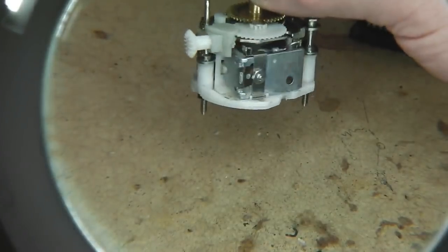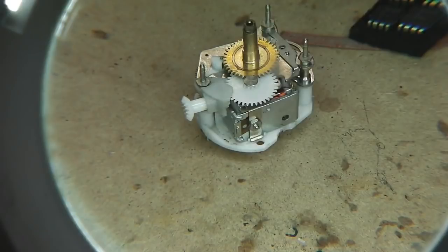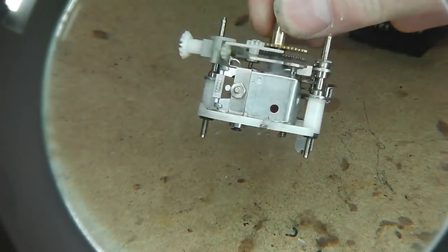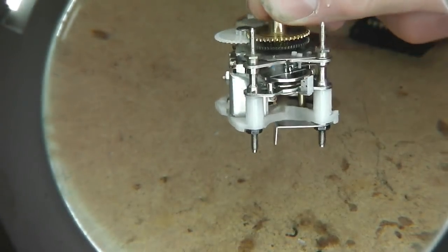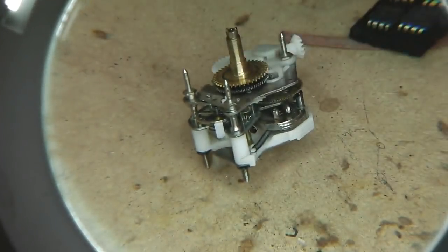And then you tap them and they start working, and that seems to be solved by blasting them with the IPA solvent. It could be that one of the very fine springs perhaps gums up on its shaft, so it's got too much force, and that the IPA solvent is fixing that fault. Enough of that, we'll move on to the rest of the dashboard build now, but that was the clock part of it.